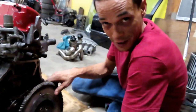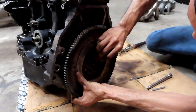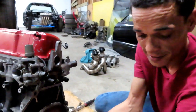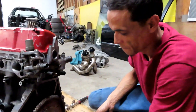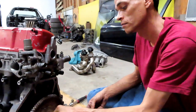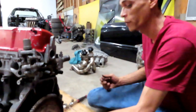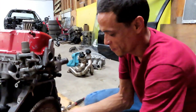This twin disc is probably a really bad idea, honestly. These single cam transmissions are super weak. We got an LSD in it and we got a twin disc clutch on it. I'd say we'll get a couple passes out of it — probably. We could do a lot of roll racing with it, but definitely once we start digging it's gonna say bye, especially with the slicks. If we put the slicks on, dude, it's done. Hopefully we just break axles.